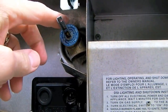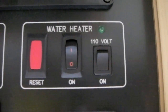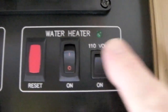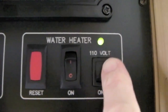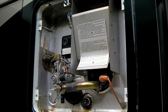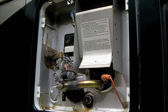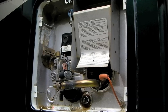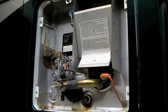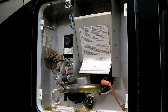Come inside and turn on either your electric or propane hot water heater. Once the water is finished heating, turn the heater off. We didn't have a lot of scale come out of the tank, so I'm going to go ahead and empty the vinegar out now. If you had a lot of scale come loose when you first flushed the tank with the wand, you might want to wait a few hours or even overnight to give the vinegar as much time as possible to break down the scale.